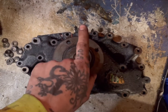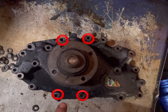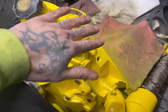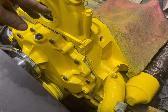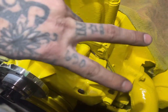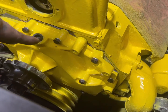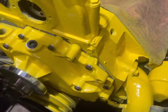Looking at the pump as it faces on the vehicle, with a water neck here and here, the bolts that need thread sealer are the two uppermost and two lowermost — you can think of it that way. The two that need sealing are the two uppermost closest to the injection pump housing and the two below. It does come with a gasket — use it, and make sure that surface is absolutely clean because it's just a sheet metal facing.